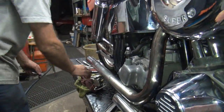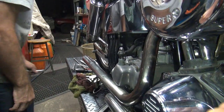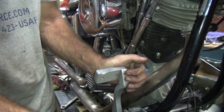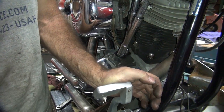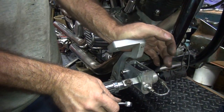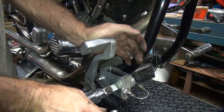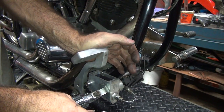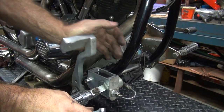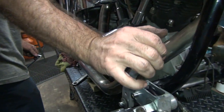Can you go over there and work the brake? Sure. Put pressure on it. You got it? Down? Yep. Feel it flow. That's enough to make the brakes work. Mm-hmm. Not bleeding any air out of it yet. I'm sure there's air in the system still, though. Yep. Can hold that there.